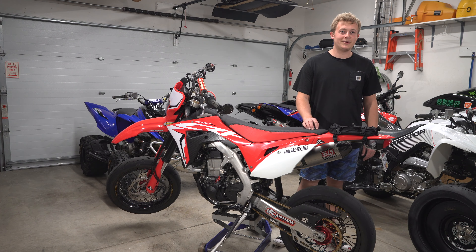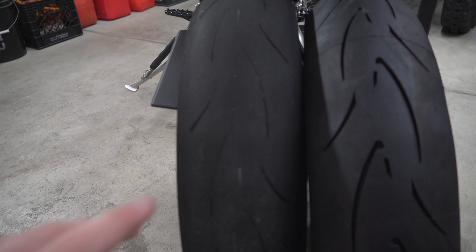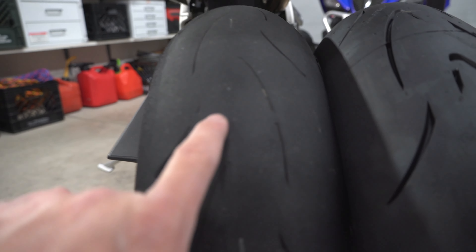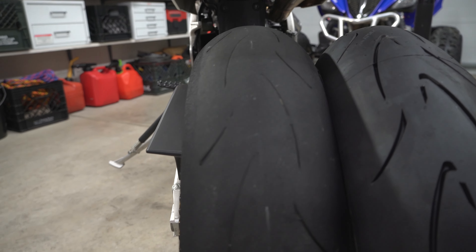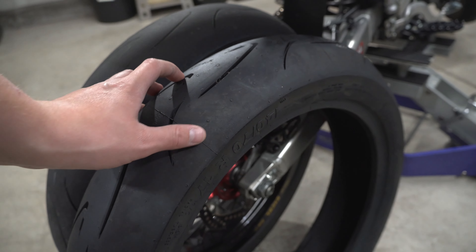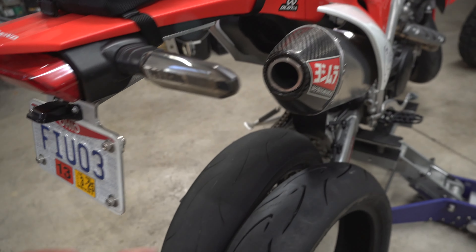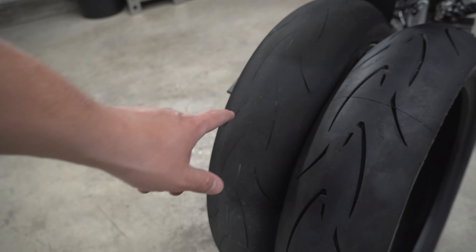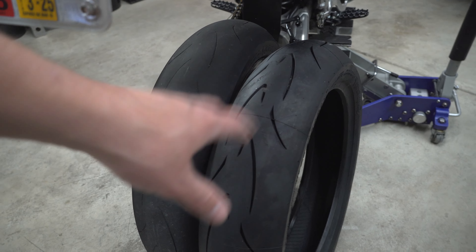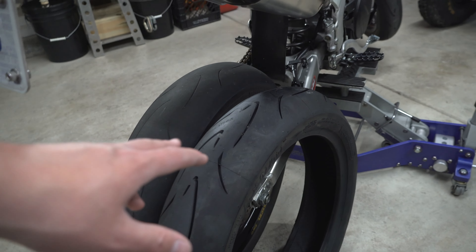So we're going to be swapping the tire on our Supermoto today. I always think it's kind of cool to show the wear on the tire — this is kind of where we like to call it when we need a new one. You can see we're down to the wear bars here, and it's really consistent wear. We go with the 140-70-17 on the CRF450L because on this bike there's a lot of chain slap and it's already jerky enough, so the 140 kind of eliminates that chain slap. It's not near as common as the 150, but for this bike it works really well.